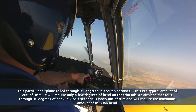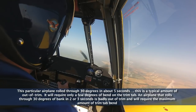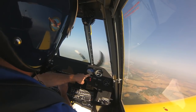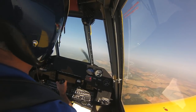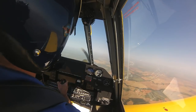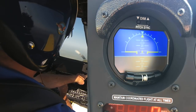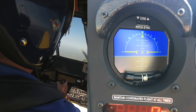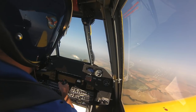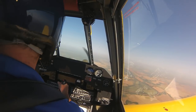Next I'm going to evaluate rudder trim, or yaw trim. With my hand on the controls holding the wings level, I'm going to take my feet off the pedals — feet flat on the floor — and make a note of the airplane's natural yawing tendency. The nose swings over to the right, which means the airplane needs a little bit of left rudder. I'd say that's about a ball and a half, maybe two balls. That's actually not a lot of out-of-trim and will be easy to fix on the ground. We'll head back to the airport, make some trim adjustments, and see if we can get this thing flying perfectly straight.